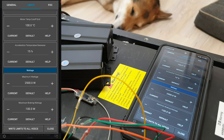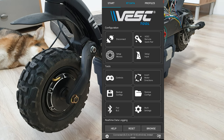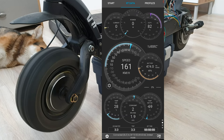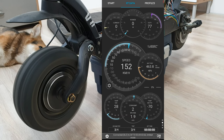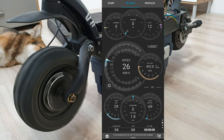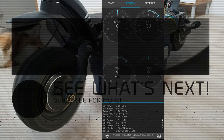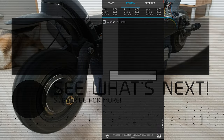And we are actually ready to go — almost, because I have to place all the wires and both controllers inside. On the top we've got RT data, which is like telemetry. On the first screen we've got lots of fancy clocks. When I hit the throttle and brake, you can see live data. 182 km/h is wrong — I will have to change the wheel diameter from 283 mm to maybe 200. We've also got some other menus with extra data.